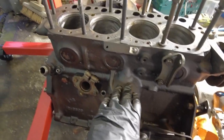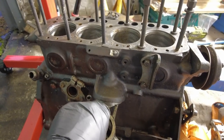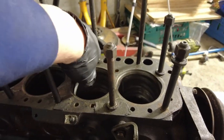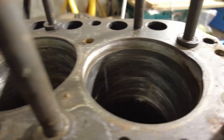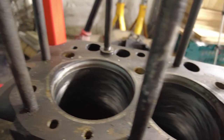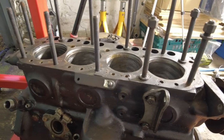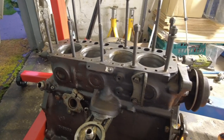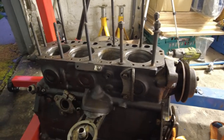I don't have the engine in the stand I bought for it, which is kind of annoying, but it's sitting on the floor on its oil pan — and the oil pan is getting painted anyway so it really doesn't matter for now. I'll get around to it and just buy some longer bolts, that'll be the solution. The engine block has been superficially cleaned but it needs deep cleaning, painting, and we need to measure those bores. I can feel a ridge there — it's bad. I've run the honing stone through the bores already and I think I'll probably end up living with it.